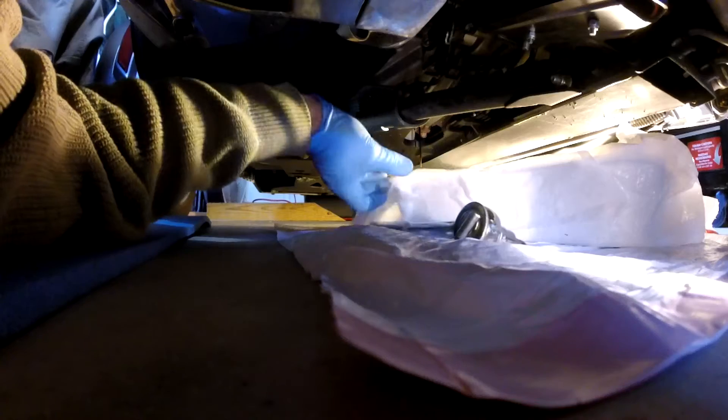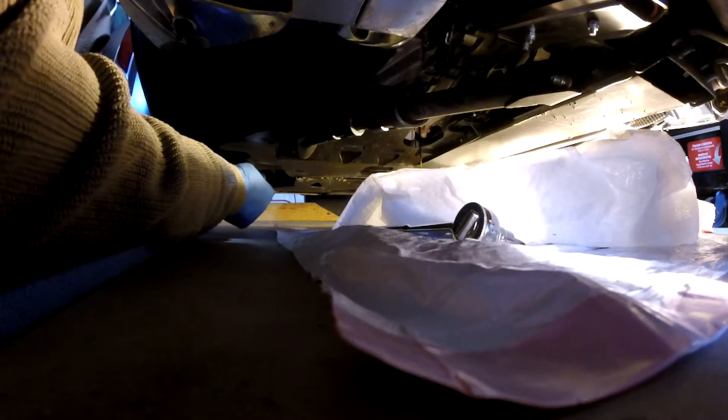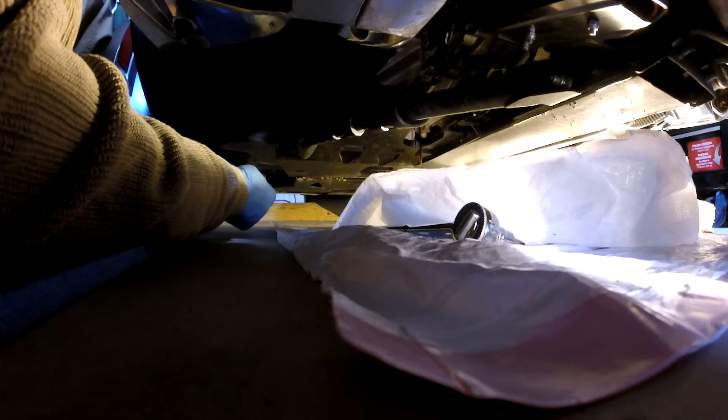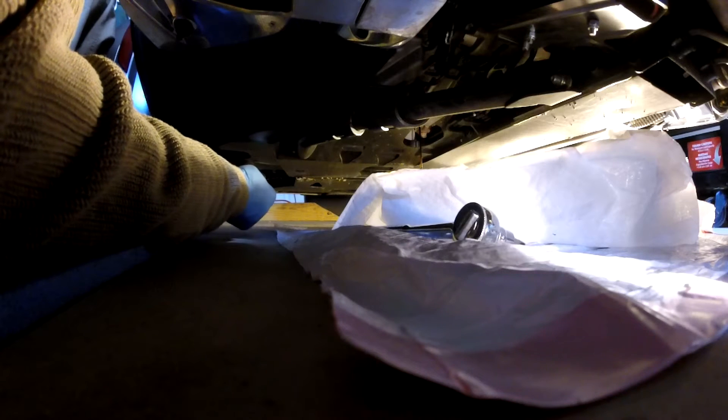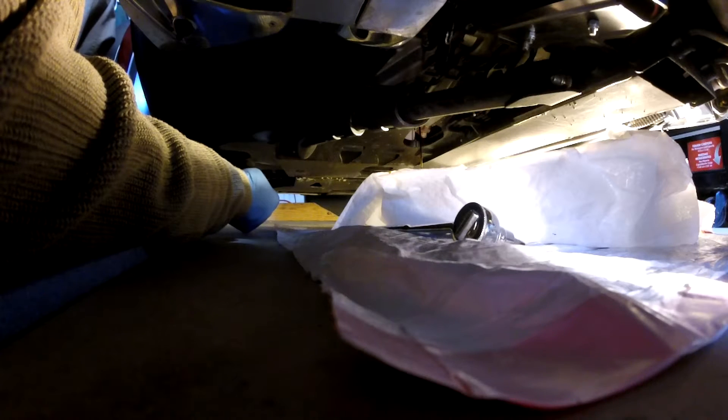That wasn't as bad as I thought. The recommendation from other mechanics is to not remove the drain plug immediately — let the oil drain out, because it'll drain in a nice slow even flow into your drain pan and that way minimizes the mess. Once we do that, we're going to let it drain, then move around to the other side and open up the transmission drain.